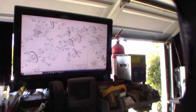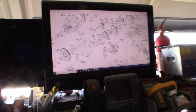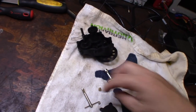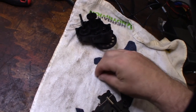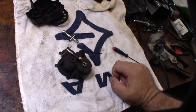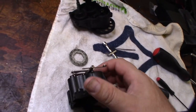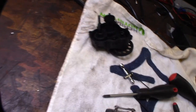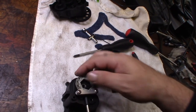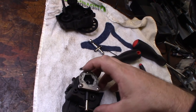I have a computer right above my workbench, so I actually have a diagram from Traxxas showing how to put this back together. You can see the little spring for the two-speed clutch right there. I'll put the clutch back in — it's basically all I need. I might put a little lube in there even though nylon probably doesn't really need it. For the brake disc, you want it in there but not so tight it won't spin — give it a couple of millimeters clearance so it can move around without rubbing.